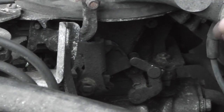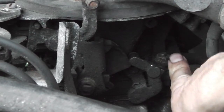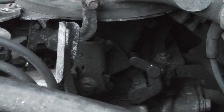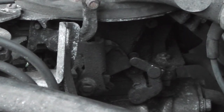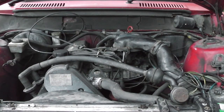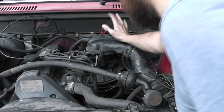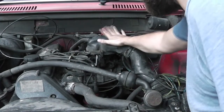There are four bolts around the base of the carburettor, with the rest hidden at each corner of the square plate underneath. All I did was tighten those up with a spanner, although they're quite hard to access. Immediately it seems to be running a bit smoother, and there's no longer any noise or movement when I press the carburettor.